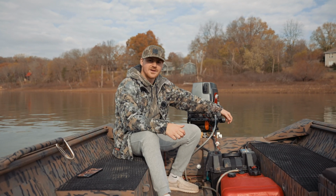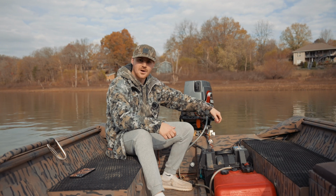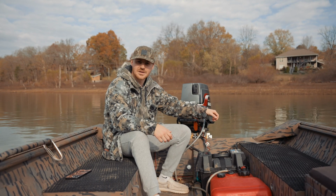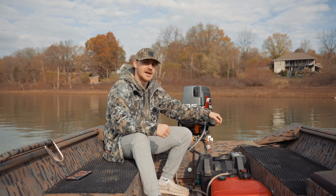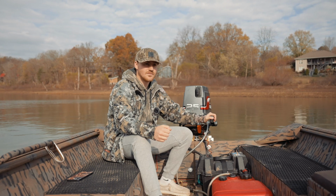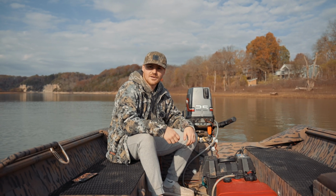All right, guys, well, that is the Bob's Machine mini action narrow jack plate. Other than what I showed you while it was driving, it runs about the same as a normal boat. You really just get the advantage of going into shallow water either when you're at idle or on plane. And you can raise it up a little bit to get on plane, but for the most part, it's about the same. I was maybe a little slower after I added the jack plate.